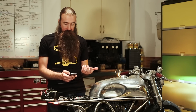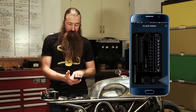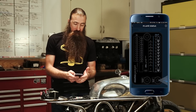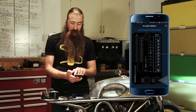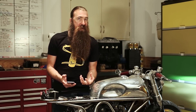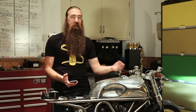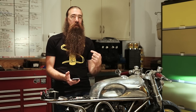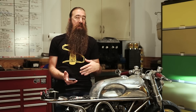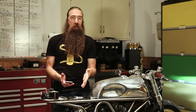I can also turn on the turn signals — both of them — and turn them off, no big deal. The app also shows real-time information: the current battery voltage, how many amps are being drawn, and how many watts that equates to. When I turn on the low beam you can see it's drawing 1.3 amps, which is 17 watts — calculated in real time. The M Unit constantly monitors power consumption of your lights, so if a bulb burns out or an LED fails, it can send an alert to your phone. This same technology monitors total current flow through each output — if it exceeds the rated limit it shuts that output down, basically acting as a built-in circuit breaker against short circuits.